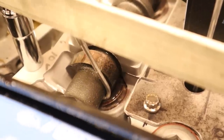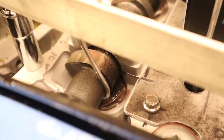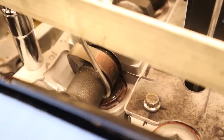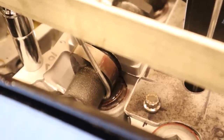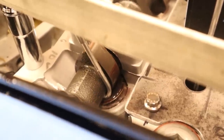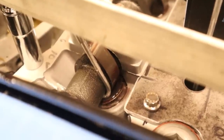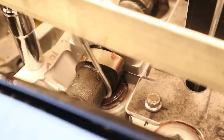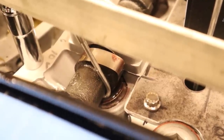The cliff notes is that I choose an arbitrary amount of degrees that I will count both advanced and retarded of the centerline to identify true center. So this is just finding something convenient on the dial indicator, and then I mark it both forward and back on the harmonic balancer. That way, just like TDC, I'm identifying the true center independent of any dwell — mark that on my crank and check it twice, maybe three times, and because it's me, probably four.